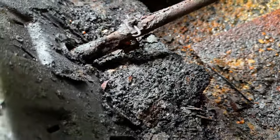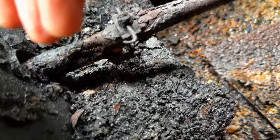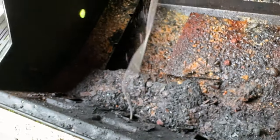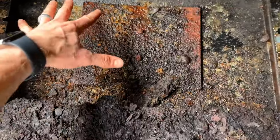This one didn't want to come out on account of the igniter. Rather than unscrewing everything, come under here — you can see the wire and trace it going up through. Pull that wire out very carefully, just like that. See that — that's what it looks like on the end. That should allow the whole burner to come out. There was just no way we were going to unscrew that thing.